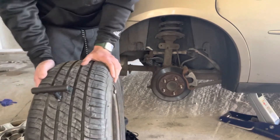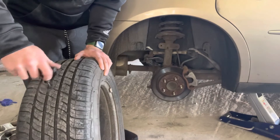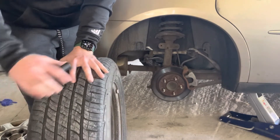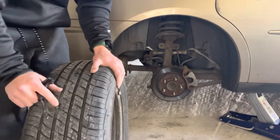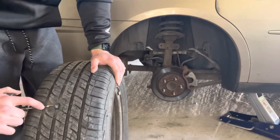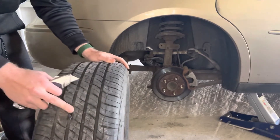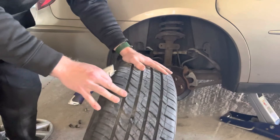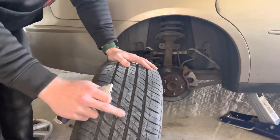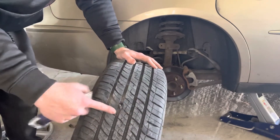I can already hear the tire is plugged right now — I know it's going to hold air. To get the tool out, rotate it a couple of times, maybe three or four. You can see it's moving. Then I'm going to yank this as hard and as fast as I can, and it's actually going to separate the rubber and leave the plug inside there. Just like that — as hard as I could. You can see little tabs sticking out, so I'm going to take my needle nose or an X-Acto knife and cut that remainder off. I had to go get a knife. This is the end result. I'm going to put the tire back on, fill it up to proper air — I'll put this one at 32 pounds. Make sure you're torquing the wheel back down before you put it back. That's how you want your plug to look — you want it to look flush. Run it over a few times on the road and it'll get all the way down in there. The reason you want it flush is because if the tabs are too tall, it's actually going to rip it out of the tire when you drive.